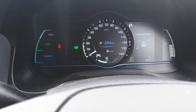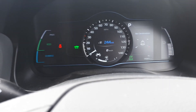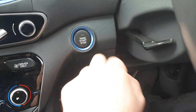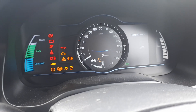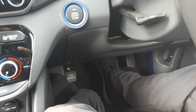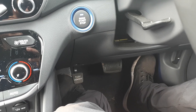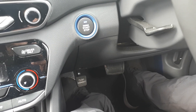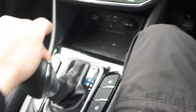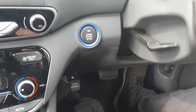Or you can do the proper way: put ignition off, then without pressing the brake pedal, put ignition on. Then press once on your brake pedal, release it, then twice full accelerator — one, two. Then again on the brake, put it in neutral, then release the brake and twice on the accelerator.